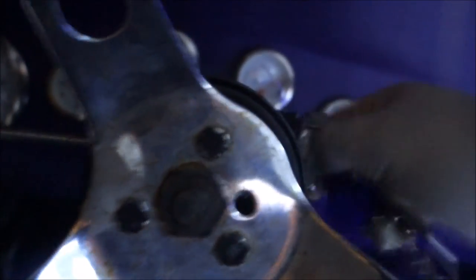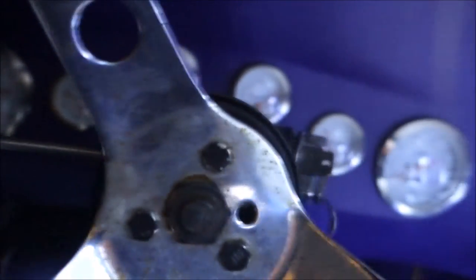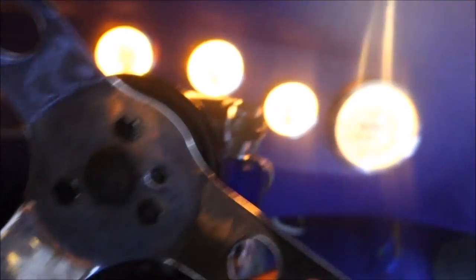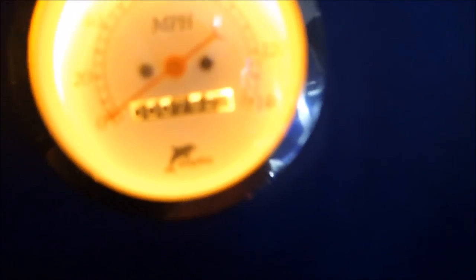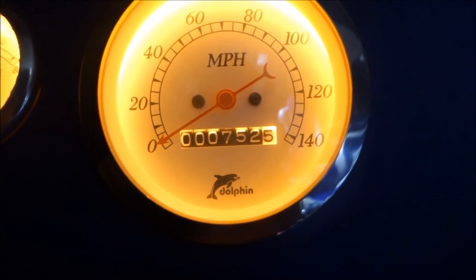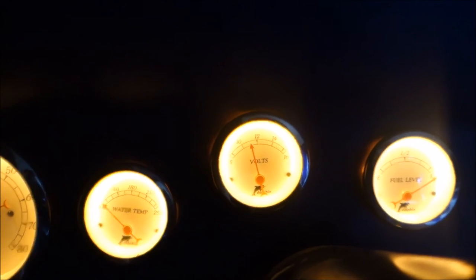She hasn't been started today — this is a new day. There we go! I feel very happy and confident in our brake pedal situation. Let's check the gauges: 752.5 miles on this car since the restoration. Oil pressure at idle is great, we've got a full tank of gas, voltage is a little low so we'll pick that up. Water temp is low obviously because we just started the car for the first time today.